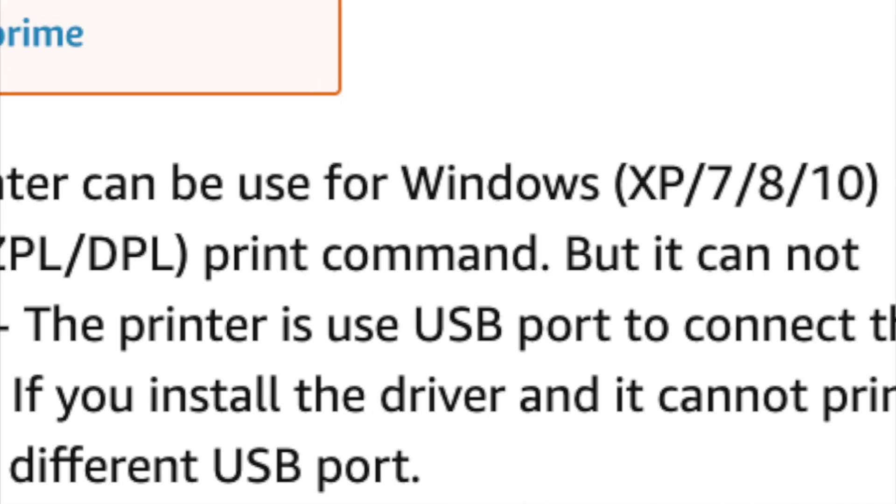Another good thing is it does work with Mac or PC. On the Amazon listing it advertises Windows only, but tinkering around I did find a driver that works fine for Mac — it prints clear, and I'll make a tutorial for that in the future. This printer also prints fast. With lower DPI, the image is less dense so it prints faster. A Dymo prints at 300 DPI so it's a little slower; this is at 203 DPI, which gives you faster prints. The trade-off is speed for clarity, and 203 DPI is the minimum requirement for shipping labels, which is why most shipping printer manufacturers use it.